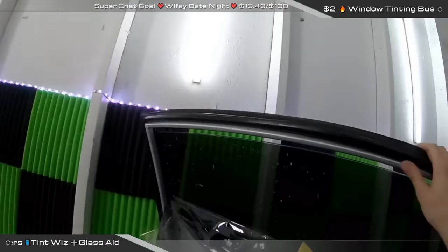I knew that question was coming — on the Civics with the shitty rear glass and the spoiler, the easiest way is to probably take off the spoiler. The second easiest way is to try and splice around it. I tinted just past one of the bottom defroster lines that gets covered by the spoiler — there's a defroster line that lines up perfectly with the spoiler split. I tinted two small pieces in those bottom corners, seamed it on the inside, and you couldn't tell a thing. If you want to do them all in one piece, they're just really difficult.